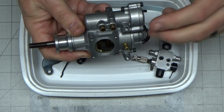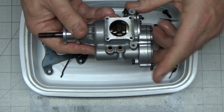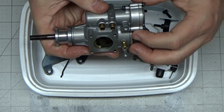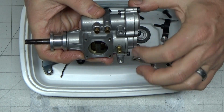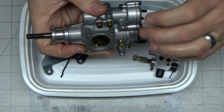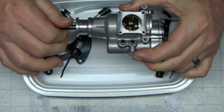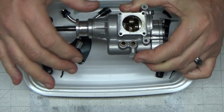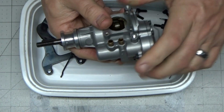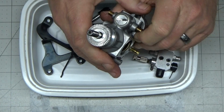Another reason is that if I don't change the bearings in it, maybe I won't have anybody asking me if I want to sell this engine. That's a minor reason. But the other thing was, I didn't have a replacement gasket set on hand either. Now this gasket here came off fine, but after this one had been in the LA's Totally Awesome cleaner, if I would have pulled it off, I'm certain that gasket would have been destroyed. So I did go online today on eBay, and I found the last engine gasket set for this engine that was in the Horizon Hobbies website, and I purchased that, so I'll have that on hand in a few days, just in case I eventually end up doing bearing replacement on this.